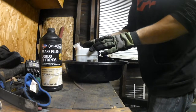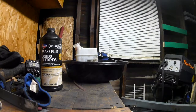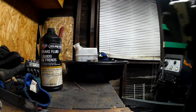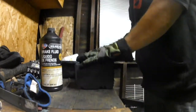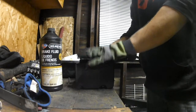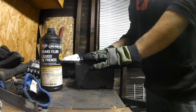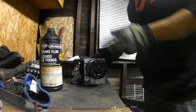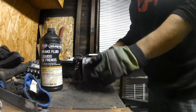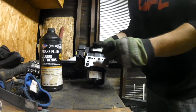If you're watching this video, you're probably doing this on ABS systems. You've got to make sure you bleed the ABS pump too. I found this out the hard way — if you bleed the master out, all the air goes to there too. So you've got to make sure you open each one of these individual lines up.